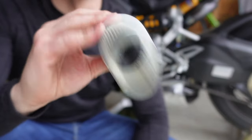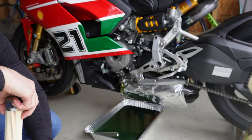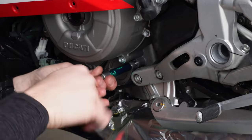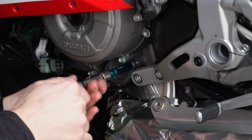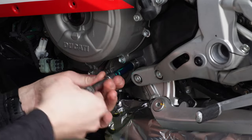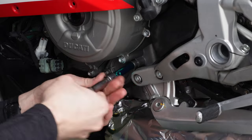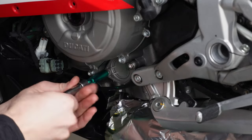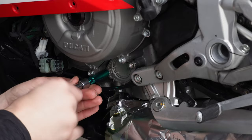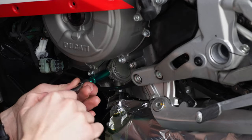Make sure this is the side that goes into the motor, and this is the side that should be facing you as you put it back in. Once you get the filter housing on, wrench it in a couple millimeters at a time on each side — it's a press fit, so you want to work it in evenly. You'll feel it start to bind up, give it a couple turns per side, and it'll bottom out eventually.